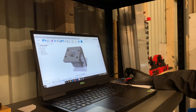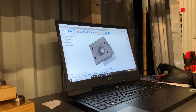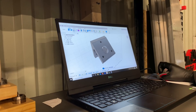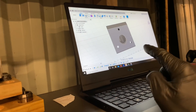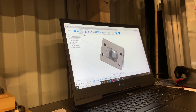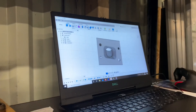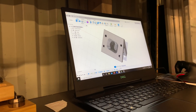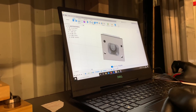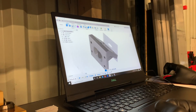This is the non-wastegate version. This is the turbo side of the flange and then the engine manifold side of the flange. What I'm basically trying to say is that we modified this section here so it actually follows the flange. It's not really massively noticeable here but it is noticeable on the vehicle. So that's been modified in Hypermill — this is the initial model. We have this nice flowing curve so we can get from the direction change, so the gas is out here rather than a square corner.